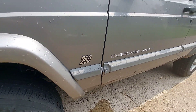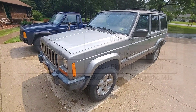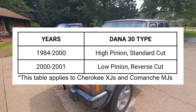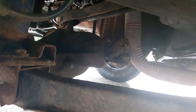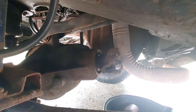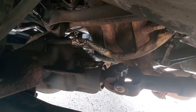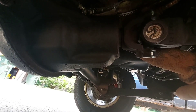In model year 2000, for a reason still unknown to this day, Jeep replaced the highly respected Dana 30 with a low-pinion version of itself. Some early 2000 models will still have a high-pinion axle, but everything after that is a low pinion. The difference between a high and low pinion axle is where the driveshaft enters the differential. On this '87 MJ it's above the centerline of the axle, while on this 2001 XJ the pinion is clearly flat and lower down.